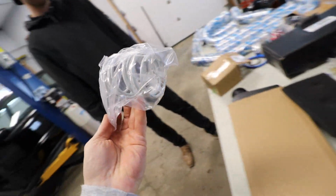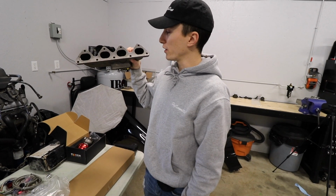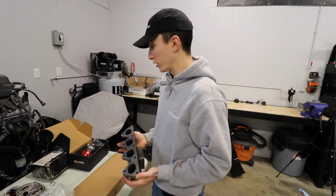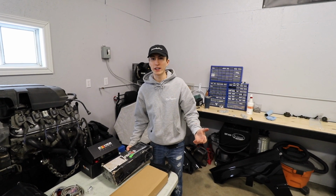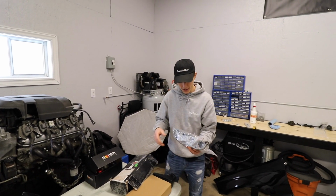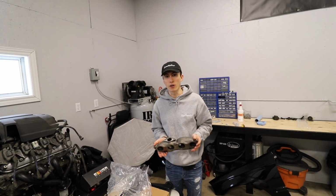There's just a big thing that happened in this video that we didn't notice at the time, but you guys called out, was that this manifold that it came with is for a D series or a B series. This is not for a K series. Very obvious now that I know what I'm looking for, but literally 5 days ago, after dealing with these guys since the day I put out this video, the whole point of this was to do an eBay turbo kit. I didn't want to spend like 800 bucks on a sidewinder. That's more than the whole turbo kit was. They were nice enough to send out the correct K20 little stubby turbo manifold, but it showed up 5 days ago, and I've been trying to get this since 3 months ago when we unboxed this.